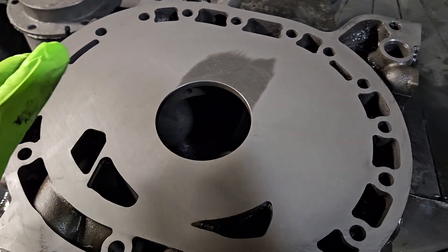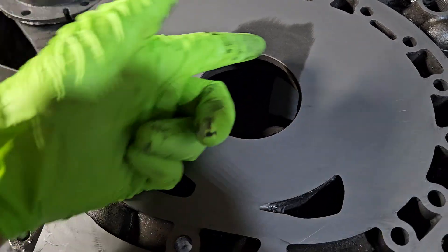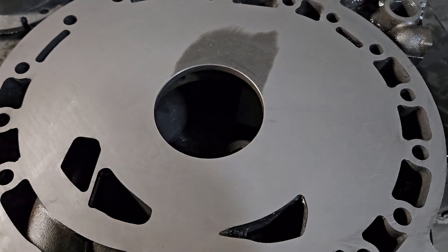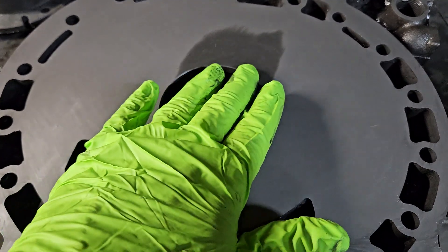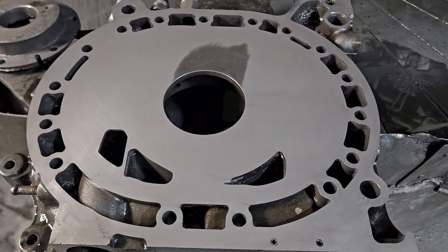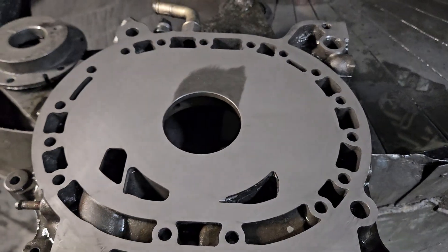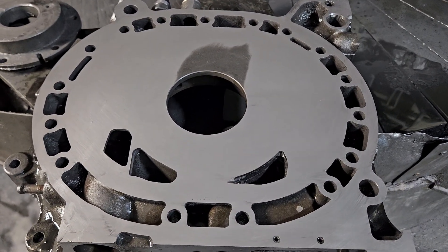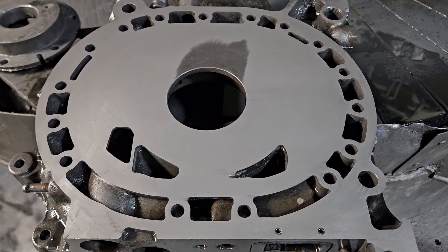The reason I agree with this is it does not look like it had been done with a fly cutter — that's a very distinct mark. It has the look of being stone ground, and upon discussion and thought, yes, it is circular, so it's unlikely that it was done with a traditional grinder or anything like that.